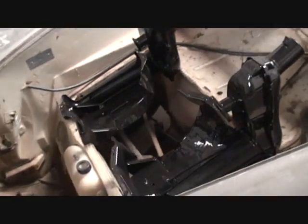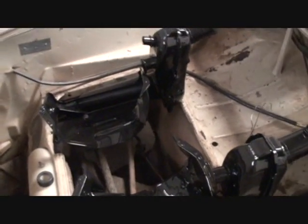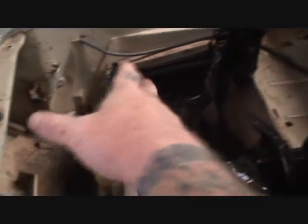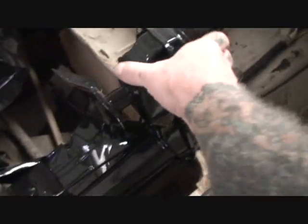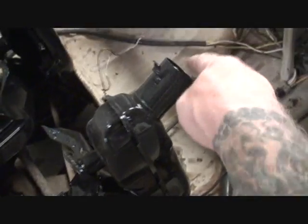So as Nader closes up his motor for later usage, we look at the heater boxes here. This is a heater box. This is where Volkswagens get heat from their car. They take the heat into the box area right here. This is actually an exhaust pipe. And then a flapper opens up to let the heat go into the car out of this tube right here. So that's our heater boxes.